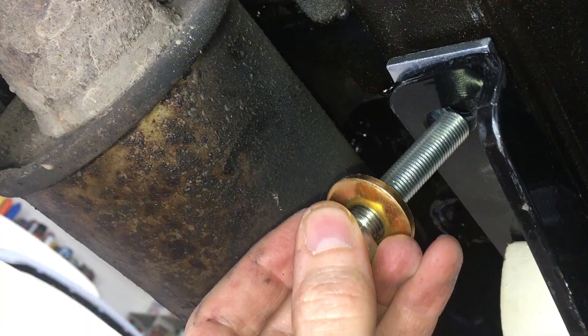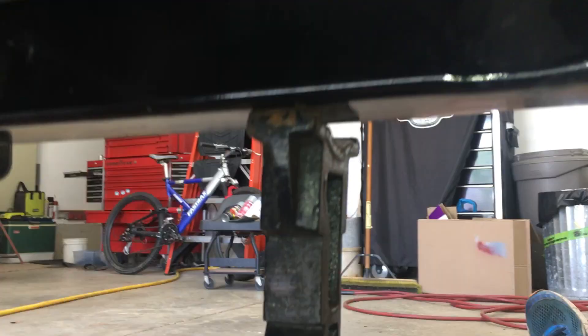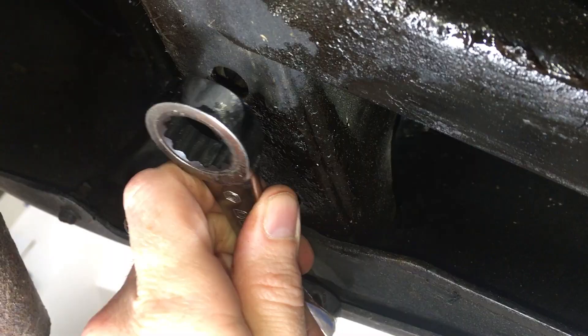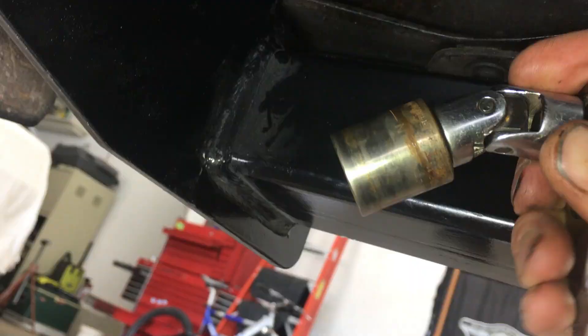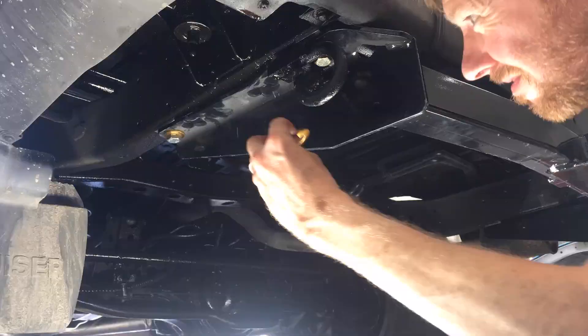There are three bolts on each side, and the most forward one on the right does have the nut welded on the inside of the frame, so I'll start there. Now the front bolt on the left side — there we go, this thing won't move on me now. I have a stubby 19mm wrench, the perfect length to hold the nut inside the frame while I tighten the bolt. That actually worked perfectly. Short 19mm socket on a universal on my stubbiest ratchet — probably the first time I've used it. The back bolt was a little more work. Everything went smooth on the left side. Then I torqued everything to spec.